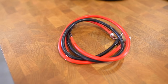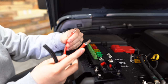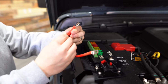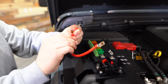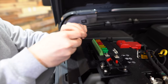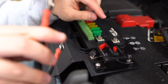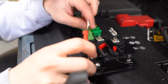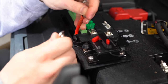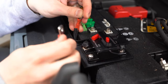To start connecting power cables, find the shorter red power cable and a length of split loom, then put the split loom over top of the red power cable. This one is going to connect to the stud over here and the bottom stud on the bus. The split loom is just there to protect the wire underneath.